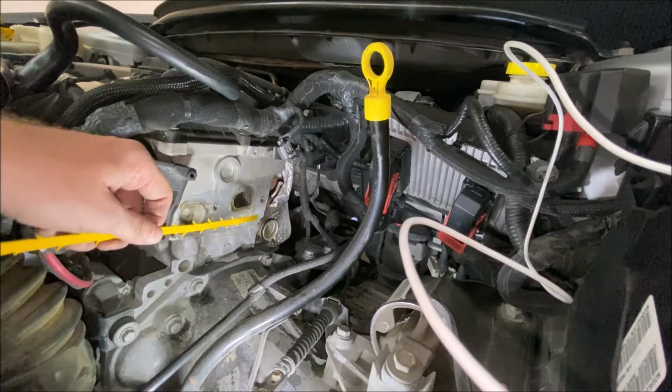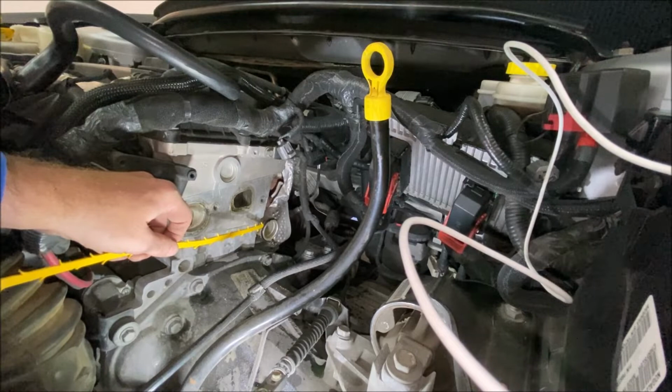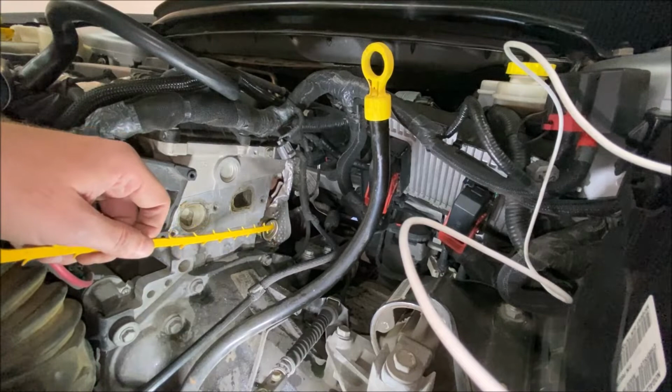Like I said, coolant everywhere. So this is the tube coming out of the engine that I was talking about, and you saw when I was taking the housing off, twisting around this O-ring to get the housing off. So that's what you're gently pulling against, just working it free of this O-ring, and you need to replace this O-ring. And that comes with the kit for the housing.